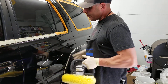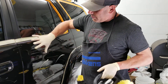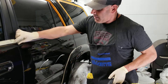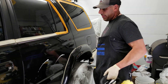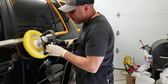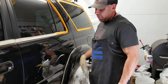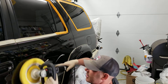Take your time, go slow, and you shouldn't have any problems. If you're polishing one panel next to another and you're worried about it, just mask with masking tape. You can mask each panel and do it a panel at a time — mask it here, mask it here. As long as the polisher's coming off the panel and rotating off the edge, you're fine.